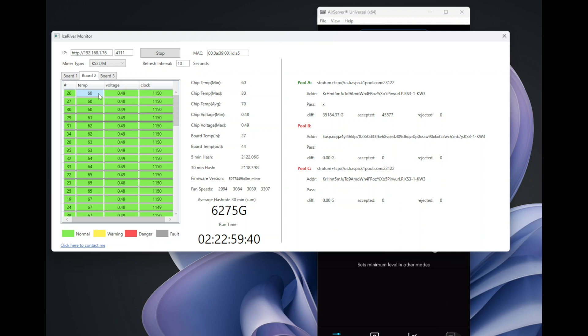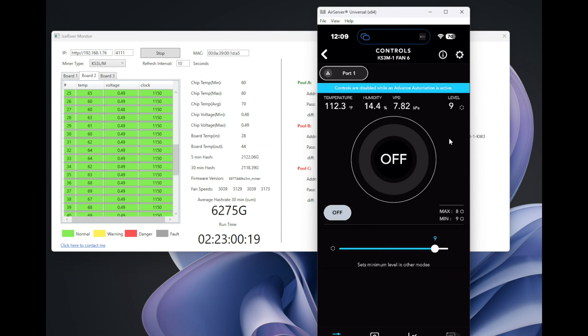On the new tool, you can click on the top line and it will sort highest to lowest temperature automatically — you can pull all the highest temperature chips or organize by chips one through 56 for that specific miner. Board 2 is happy now after I fixed that reversed plastic — 62 degrees versus 106 or 108 degrees before. That's almost double, and I was running 100% fan before. Now I'm at 90% in the middle of the day, and at night I can drop it to about 70 or 60% fan speed when it's cooler.